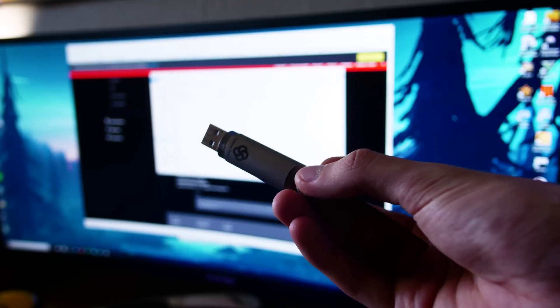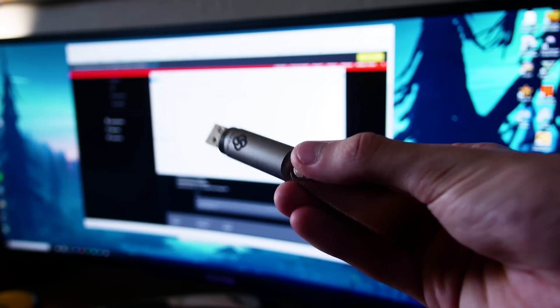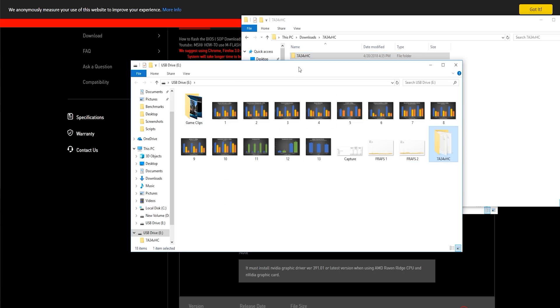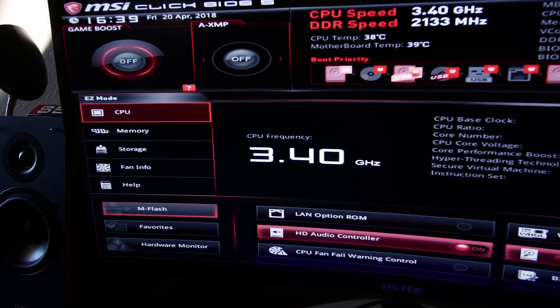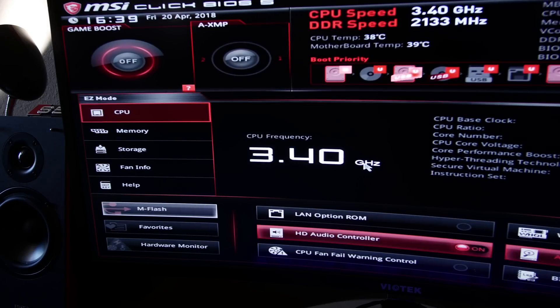This is where a thumb drive will come in handy. Plug it into your system and drag that entire folder onto your thumb drive. Make sure it's still plugged in when you reboot. So drag the entire folder containing the BIOS onto your USB drive, then restart your system and keep spamming Delete until you're prompted into your BIOS. Now depending on your vendor, you're going to see an option similar to MFlash — or in the case of Gigabyte, it's called QFlash. This will basically reboot your system and enter flash mode. There might also be a dedicated switch to do this without going into your BIOS directly. Click on it and then your system will reset and try to locate that BIOS file.